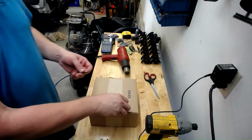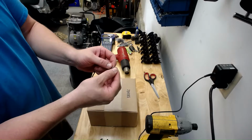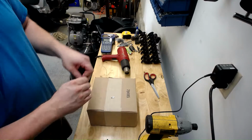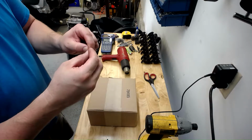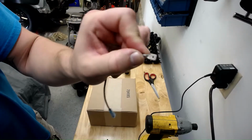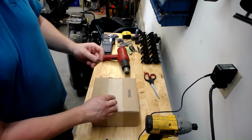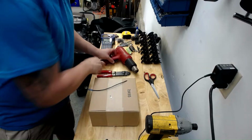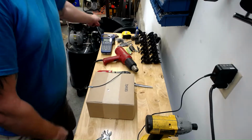What I'm doing, take the wire, take your terminal, stick it in. If you got a little wire sticking out, pull it out, give it another little clip, make sure you're good. So put it on there, make sure you don't have any wire exposed at the end. Camera come in focus a little bit better, but so once you have that, you know you have your size. Had a piece of heat shrink ready, seemed to disappear, so we'll grab another piece.